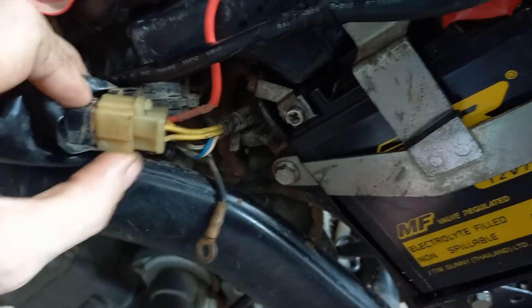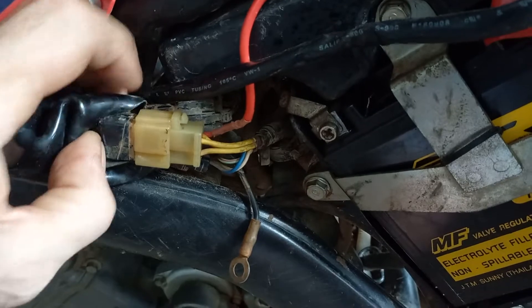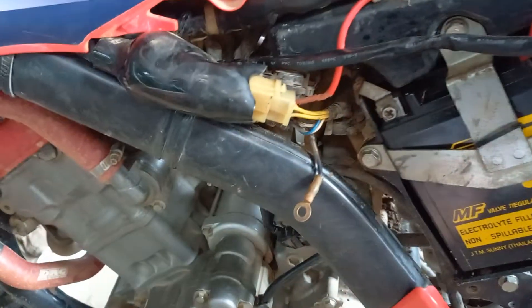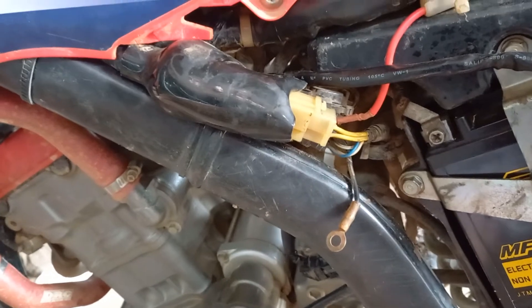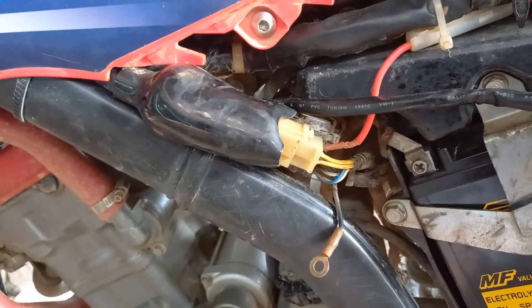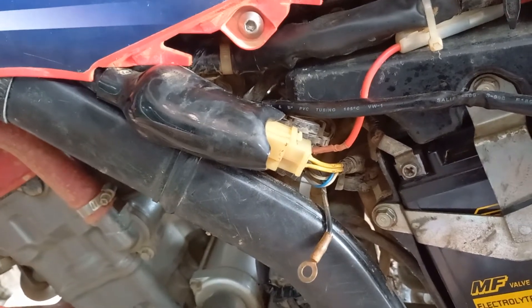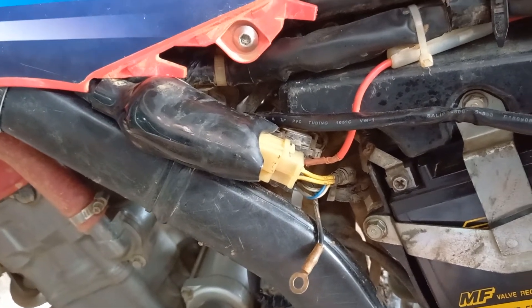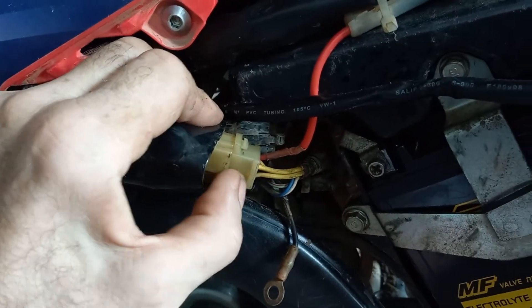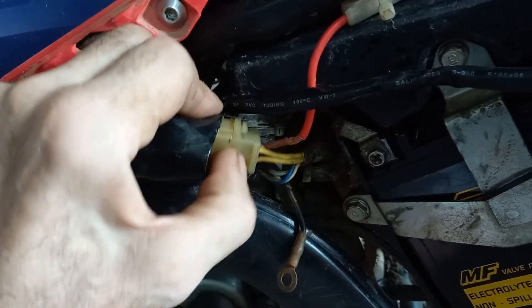The yellow wires — the three wires from your alternator — were red hot. That's quite a common thing on motorcycles. You go on YouTube and you'll find loads of videos about where that plug just catches fire and melts because it gets overheated. But generally speaking, it's usually because of oxidization and bad connections on that plug.